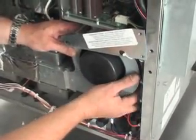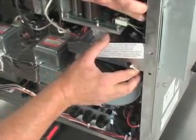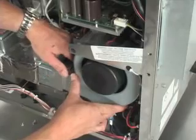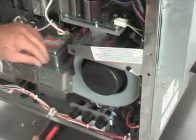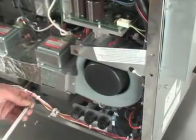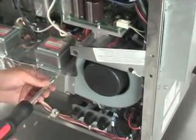The rear fan mounting bracket should be located behind the oven frame. Be careful not to damage any nearby wiring harnesses during installation. Now secure the fan unit in place by reinstalling the three screws you removed earlier.